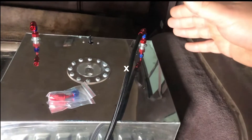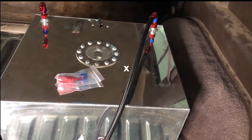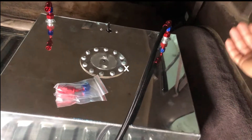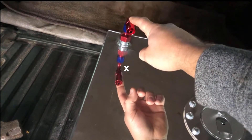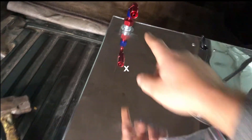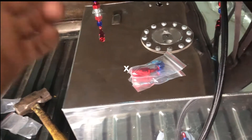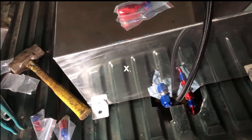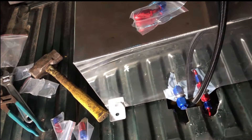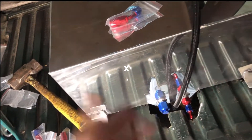The fuel goes through the fuel pump to the intake on the fuel rail. The fuel pressure regulator regulates it, and then what it doesn't use it sends back up into the tank. This right here is going to be a vent. If you care about the environment — which you should — the vent is going to run from there down into the charcoal canister from the factory. Now if you're working on something older, maybe carbureted, the vent can run just underneath the vehicle so you don't have any fumes inside.